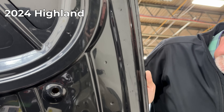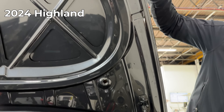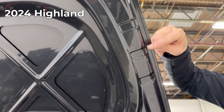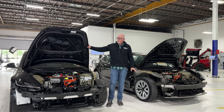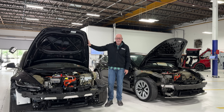It can be repaired, but it's pretty tricky to repair. So in a lot of cases with this hood, you wind up replacing it with minor damage. You can see in the image a very different structure — this sort of pentagon shape versus these X's. The big difference is that collision dam is gone. It's reinforced — I can see some spot welds underneath — so it's going to be much stronger in the hinge area. They've added some collision dams forward of the old location. That seems to be a super smart thing, and it's probably going to bring the cost of collision down substantially, because these hoods won't fold like they used to.